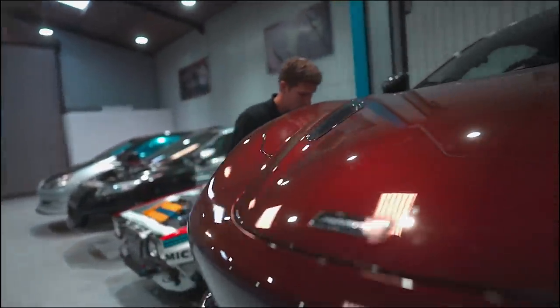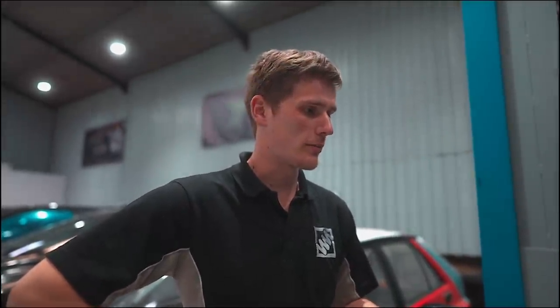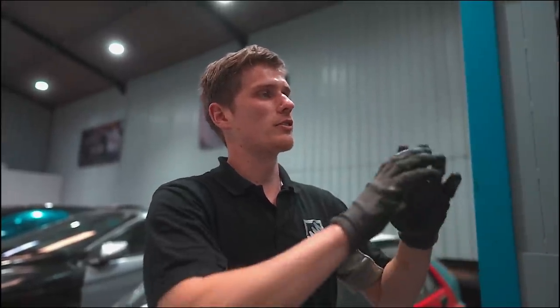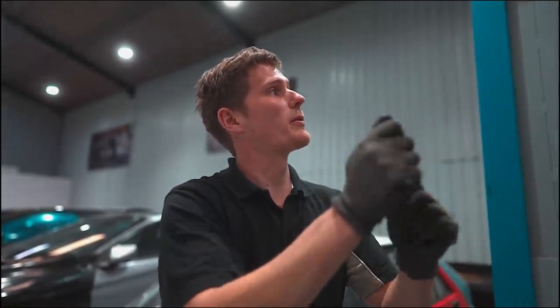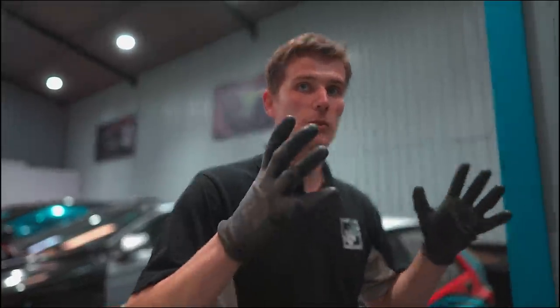What's your advice for people? Because some people would say you can just go to Quick Fit or something and get an alignment done, but this is completely different, right? Yeah, it's more the level of accuracy that we go to. On a lot of the laser system stuff, there's a screen, and when the screen goes green, you stop and tighten it up, and the numbers can be slightly different, but our settings are always exactly the same side to side, perfectly. This is a setup that's been tested and proven to improve the handling. It's our settings, so we're not just returning it to manufacturer settings. If you have a knock on a rim and you want it evened out, that's where you go to something like Quick Fit. But this is more design and development settings, so it's the numbers we put on the car that really matter.